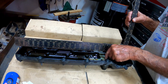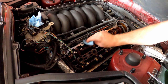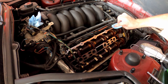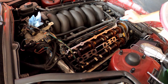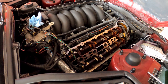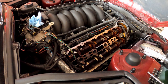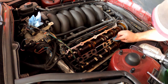There are other ways to do this — such as building up the gasket or making your own thicker gaskets — but this is the method we're going to use: just simply add a little silicone on there and it should hold just fine. I've already wiped this down with a dry cloth, so now I'm going over it with a little bit of carb cleaner to clean all these contact surfaces and make sure they're good, dry, and clean. I had to get a razor blade to scrape off some of the old silicone that was already up here, but we'll be putting a new bead there at that seam.